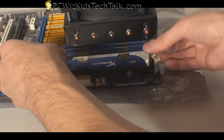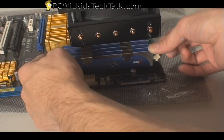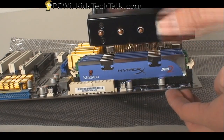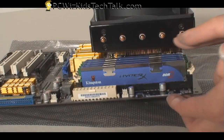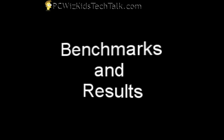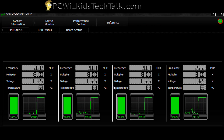The cooler is actually small enough to use in a mini tower like a media PC. If you're trying to save space, this is the cooler you want — you don't want these huge monsters. There are larger coolers that will provide more cooling, but for stock values this one is pretty good. In benchmarks, it showed 44 degrees Celsius on idle on my 2.6 GHz Phenom X4, and at 100% load running all four cores it shot up above 60 degrees Celsius.